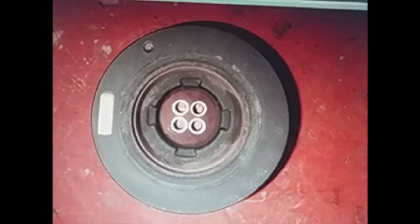How do we know that the pulley is in bad condition? We noticed a vibrating alternator belt. This happens because this pulley carries rubber bands inside that act as shock absorbers. These rubber grommets eventually deteriorate, and that deterioration causes poor movement and vibration in the car.